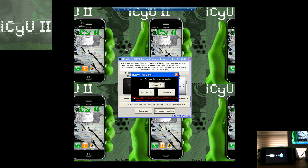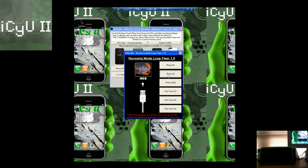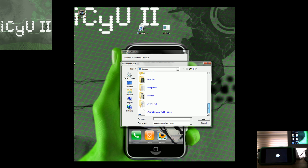Windows XP is just the best way to do it. You can look at the tutorial if you really want, but it pretty much doesn't work on Windows 7. Since I already have libUSB installed, I'm going to click 'Yes, I have it installed,' then click iPhone 3G because I have an iPhone 3G. My screen goes black and it starts to reboot. After that, if it gets stuck in a boot loop, you're going to have to run redsn0w — sorry, there are just a bunch of steps you have to do.